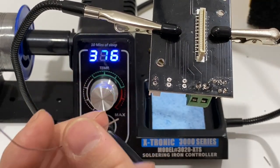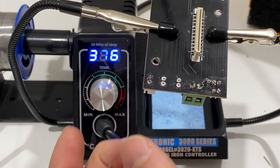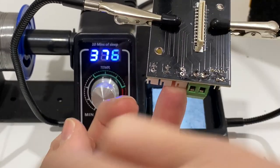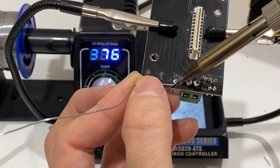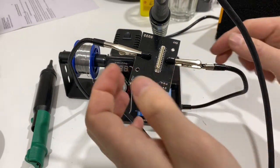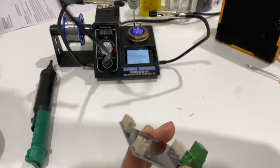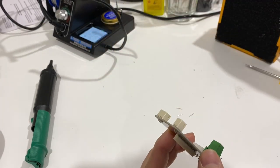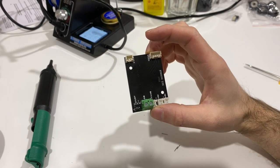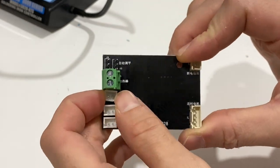Easy — this one is done. Now I'm going to turn on my fume extractor and continue with the two other sockets. Our soldering is now completed. I'll remove the circuit, shut everything down for cooling, and remove it from the way. The circuit looks like this now. I made a slight angle on this one but that's alright — as long as the connection is safe I don't see a problem. Make sure your solder joints are good and not cold solder joints.